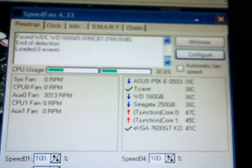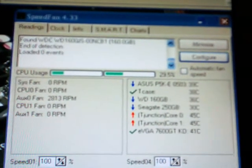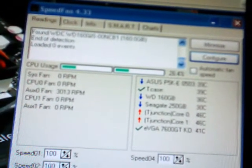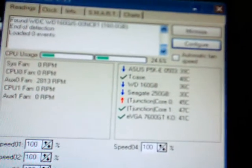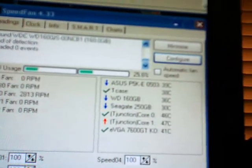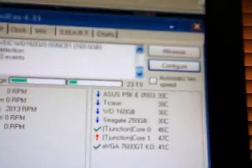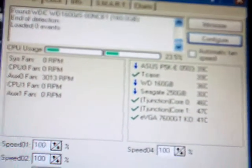As far as the test I'm doing of the temperatures of my Intel E2180 processor at the stock 2 GHz speed, currently we are idling, close to idle. Temperature in the room is 78.1 Fahrenheit. It's hard because I have Orthos open right now, but idle is around 42 to 45 — as you can see it's about 45, 47, 48 right now, 45, 46. Everything else looks pretty good.